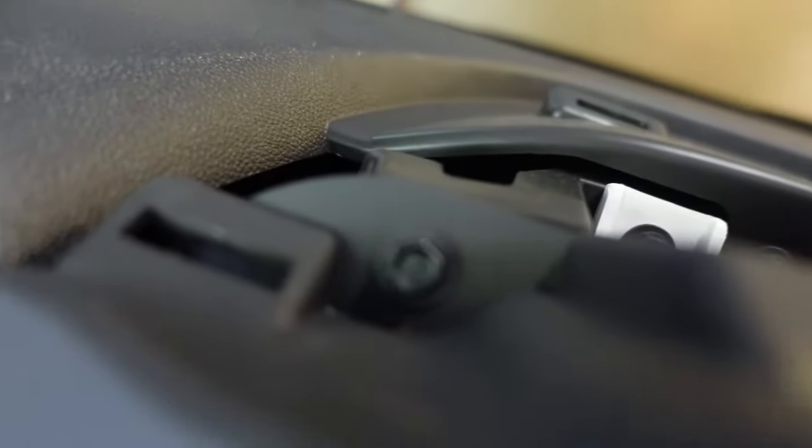Now I've got my new cluster ready — set it into place up here, then plug in the connector on the back. Push the connector in as far as it can go and then the lever takes it the rest of the way. Re-snap the locking tab, then this goes back into place and we can mount it with those four bolts.